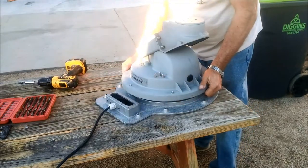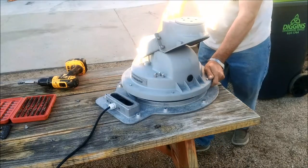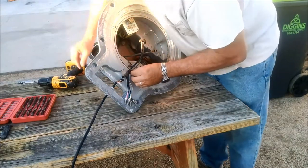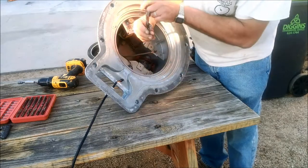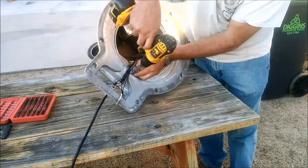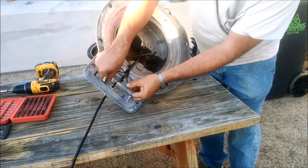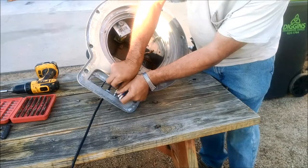Now look at this - it's just got a little lash in the gear, which is good. It doesn't wiggle back and forth and it's much tighter - definitely a much tighter fit. We're going to flip this back up. Take this short screw, put it on this side with the clamp facing down so it holds the wires up into this groove and tighten it up. You're going to feed your cables - make sure you do it just like it was when you pulled it apart. Note your colors - black, red - that's why you want to look at it before you take it apart.